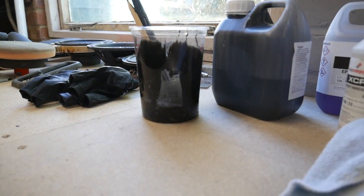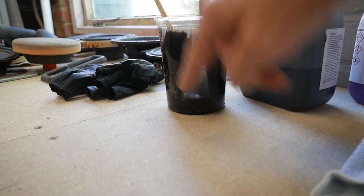Okay, it's all done now. I'm going to leave that to cure for about two hours to make sure it's nice and tacky so the carbon will stick and mold to the part nicely. I mixed up not that much base coat and I've still got about half left, so it goes a long way. If you do this, make sure you don't go crazy with the base coat — you can mix up more if you need it. Lesson learned: I don't need to mix up too much. Goes a long way.